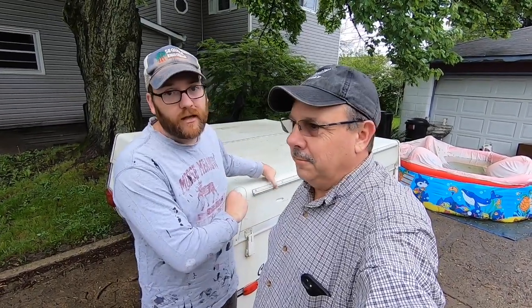We're back for round two on flipping the pop-up camper. Today is scrub day, so wear some grubby clothes because you're gonna get wet and dirty. We've done some research online and figured out the detergent situation. We're going to do a quick wash on the outside shell with water and scrub it, then use a non-detergent soap like Dawn — we're using the Costco brand. On the canvas we're going to use vinegar and water, one part vinegar two parts water.